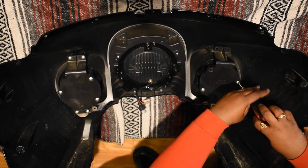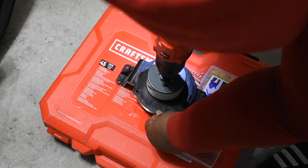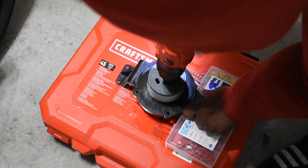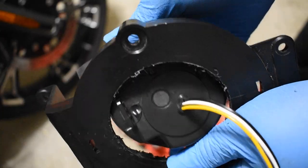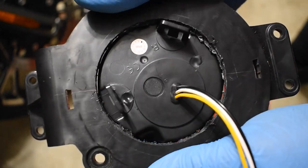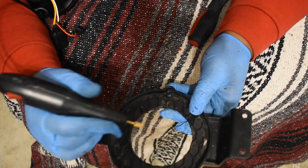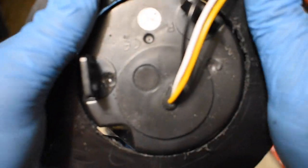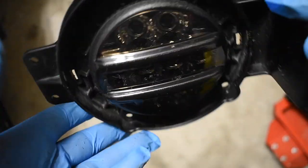As you can see I'm just removing the screws from the louvers to start out. Now I'm drilling a three inch hole into the back of the honeycomb that I just took out of the fairing. Because my process for this was a little questionable and I don't want y'all to judge me, this is all you're gonna see. Next step - the three inch piece has been cut and now I'm just popping it out and removing it. Now I'm just doing a rough fit of the light to see how much I need to dremel out to get it to fit and push through that hole. Time to pull out the dremel - now I'm just flushing that circle out, smoothing it out a little bit and making it slightly larger so that I can fit that light through. Dremeling was a success, so now you're gonna see me push the light through the honeycomb that I drilled the three inch hole into, and here's just a 360 view of how it looks once it is in there.